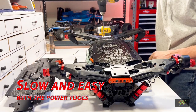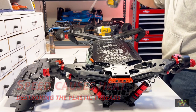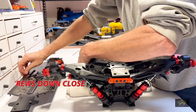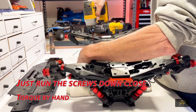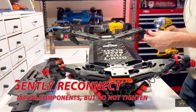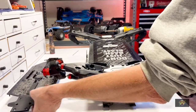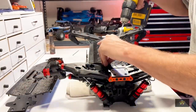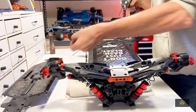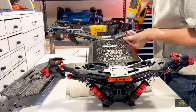Nice and slow with the power tool so you don't melt the threads in the plastic. For all the little bits on the outside, just make sure you get one screw in these to hold them in place - I like to get those on right away so you don't have to fight them on later. Go ahead and attach the front. Now it looks like I'm cranking these down, but I'm not - I'm just getting them close and I'm going to tighten all this stuff by hand. Then go after the major components: speed control, battery trays, servo. Get those all started, get them in line, and just be patient.